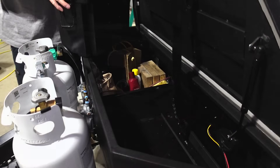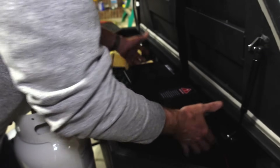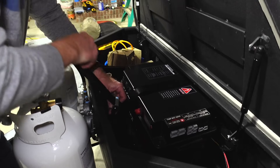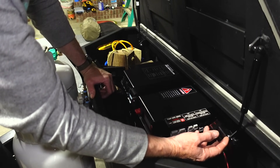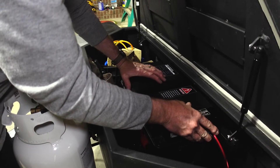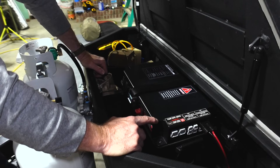Let's say we're getting ready to go camping — it's this easy. I pick up my Light City AC Heavy Duty Power Box and drop it down inside the area I made that keeps it from sliding around. I bring the strap over the top and feed it through the buckle — strap it down. It rode 2,400 miles and never went anywhere. Then I just have three simple connections to make. The black Anderson 50 amp plug comes from the solar power selector switch and goes into the black connector on top, powering the MPPT charge controller. I upgraded the original 10 amp charge controller to the Victron 75/15, which allows me to charge the battery faster and cleaner.